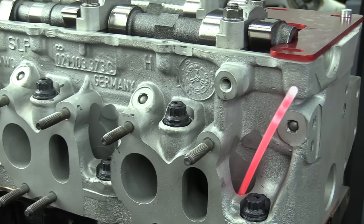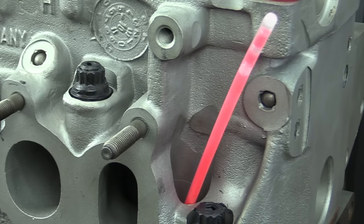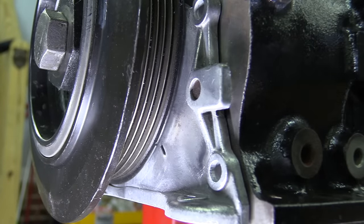You can also use an indicator to find the approximate top dead center of the Cylinder 1 piston. On this particular engine, you need to be careful because of the angle of the spark plug hole — you aren't going to have it perpendicular to the deck of the block, so the indicator can slip on you pretty easily. Lucky for us, we don't have to do it that way because we can use the marks provided on the engine.